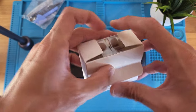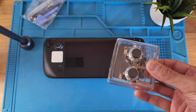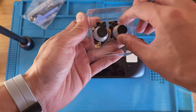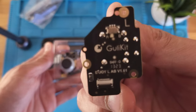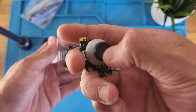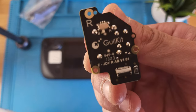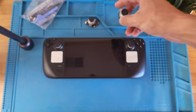Why would you want to replace the stock joysticks with Hall Effect joysticks? I push down on my sticks pretty hard when I play and I started to feel some drift occurring. Since the stock Steam Deck sticks are analog, they determine input mechanically. Hall Effect joysticks use a magnetic sensor instead, which leads to less wear because there are fewer moving parts, and a higher level of accuracy can be achieved.